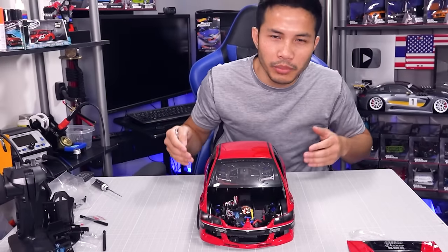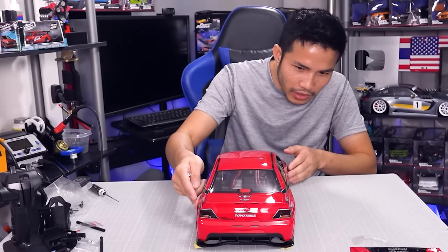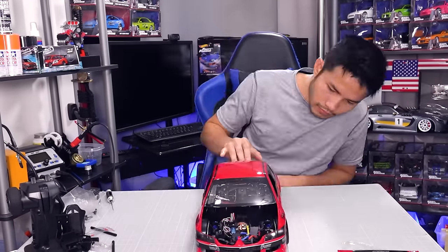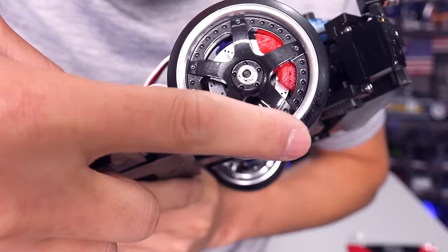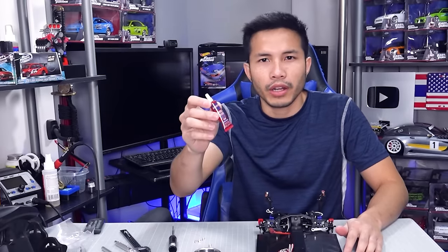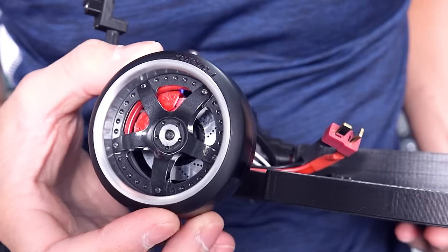The front wheels are pretty much perfect. The back wheels will need to come out a little bit more. The calipers are very close to the wheel. It's insane. I'm using a little bit of thread lock blue to lock the wheel nut. You have to be careful with the thread locker. Don't let it touch any paint because it will ruin the paint.